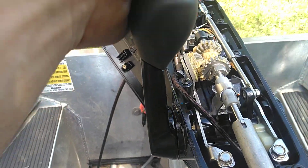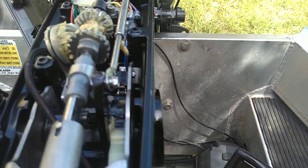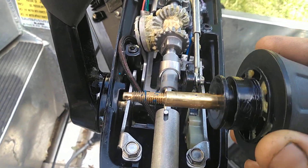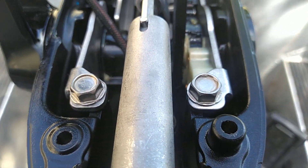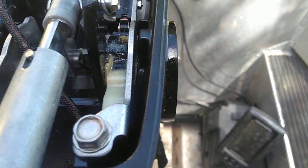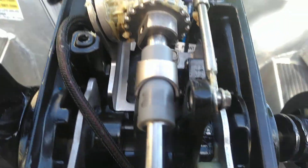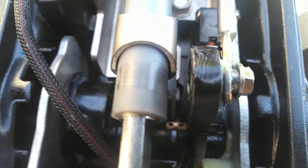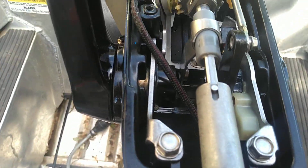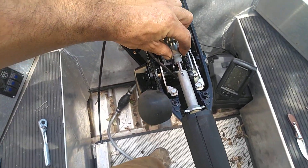There's just a large Allen wrench right here that I took off. That's the easy part — moving this shifter — because it's one Allen bolt and it's wham-bam over there. But your friction adjuster right here at the end, there's a little cotter pin and also a small washer, and the tricky part is that washer. You got to drop it in there at the right time, get your stick right there, and then run it through that tensioner.